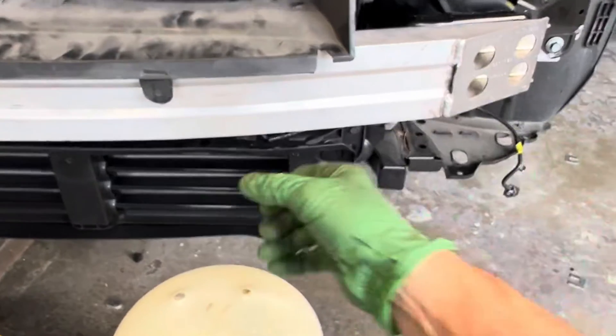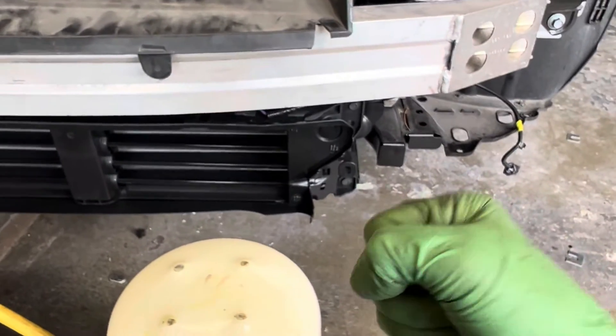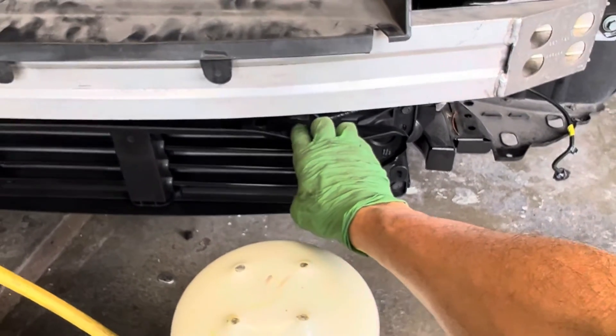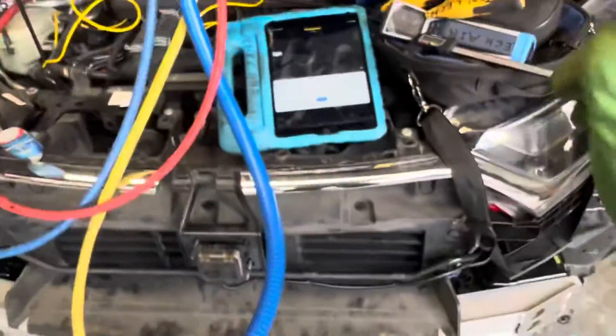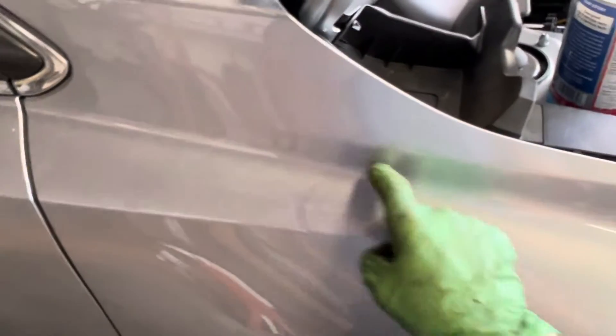You use a thermometer and try to get it to about 100 to 105 degrees. So you get your hair dryer — not a heat gun, a hair dryer — and pull it away so that on your inner dash you can read about 100 degrees off this thing here. And if you have a sun load detector, especially if you're in a body shop with one of those really bright lights for looking at the color of glass, go over to your sun load detector and put your really bright light right into it. There it is — I can see the sun load detector right there.